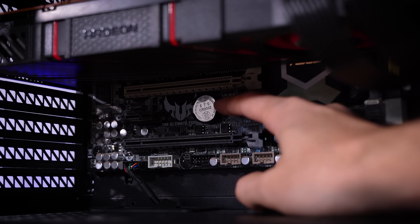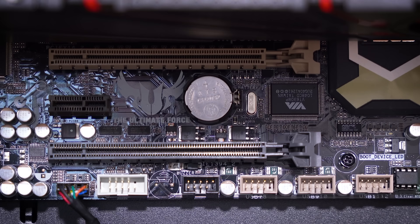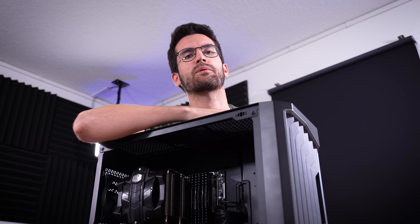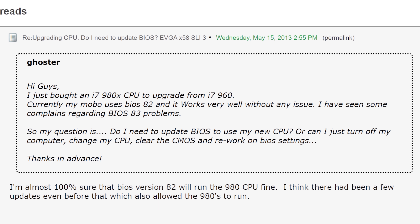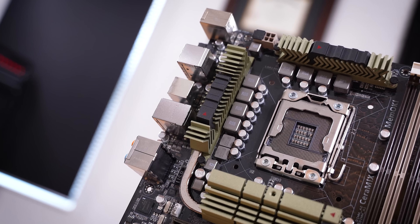Which means we need to go deeper. From the earlier video, we did check the voltage of the original CMOS battery — it was reading below one volt, and it's supposed to be three — so we swapped it out for a brand new one and cleared the CMOS in the process, but still no fix. That doesn't rule out a BIOS incompatibility, and while I couldn't find any concrete evidence online, it looks like this motherboard may need one. But that's going to require removing the CPU cooler, which was a major pain to install. I like to save the more complex stuff for later — maybe it's RAM or graphics card related, let's check those first.